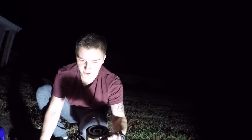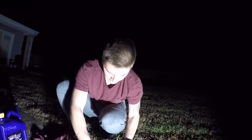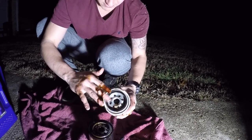But anyways, you have your old filter and your new filter, and I'm slinging oil. What you want to do is take some of this oil and lube that up. That was a little too much. That's good. But yeah, that's all you need. You want to make sure you get this on there pretty snug. You don't want to tighten it ridiculously tight because it's not necessary. So our new K&N filter is now on.